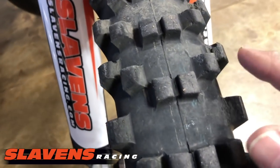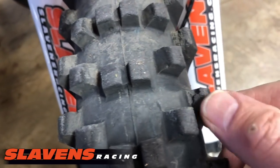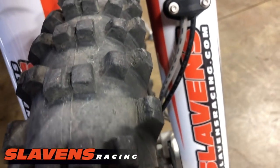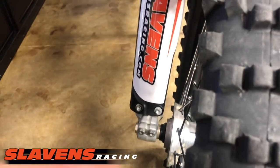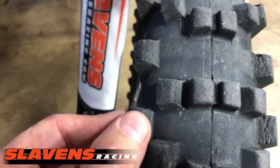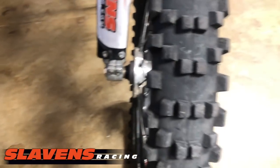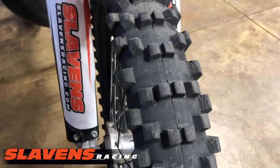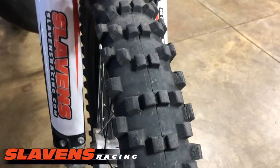You can see that this tire here is starting to show some signs of the side knobs coming apart — part of one has kind of torn off. There's really not much cracking on it; there's a little bit of a crack on this one knob right there. That knob will probably eventually come off if you rode it four, five, or six hundred miles. But it depends on what your goal is. If it's mileage, then go buy a hard tire and just deal with it. If you want performance, there's a cost for that — tires don't last as long.